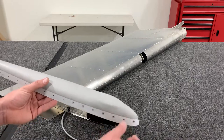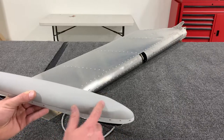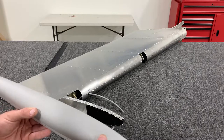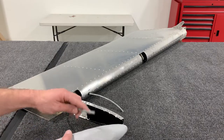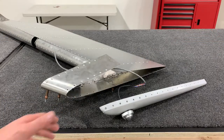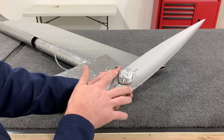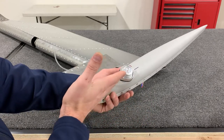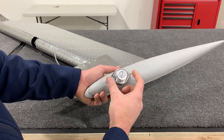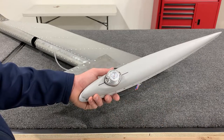Before permanently riveting the rudder tip on, use the flat spot on the tip and mount your tail strobe exactly in the center of it. It's a good idea to have your tail strobe selected ahead of time so you can make sure the mounting positions are exactly as they should be. It's much easier to run your wire through and get all wiring done with everything disassembled before permanently mounting it. Take a straight edge from tip to tip and mark a short straight line down the center of the flat area, verify it is in fact centered, then move the strobe forward and back along that center line to find the widest point of the curve where the light will nest best.